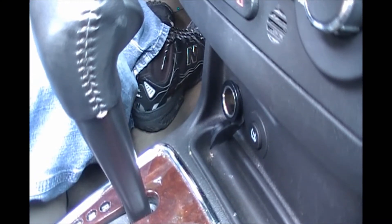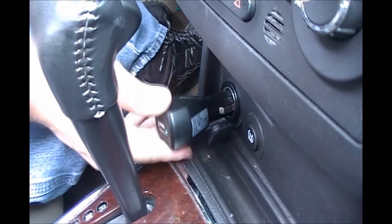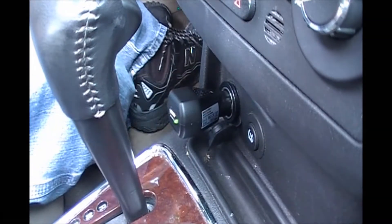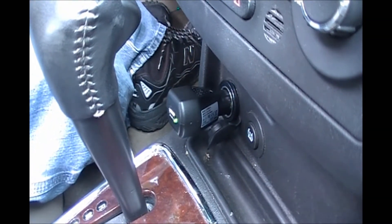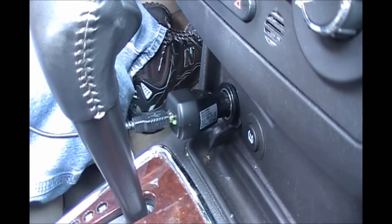After you've connected the cable to the booster, you now need to provide electric. Take the included cigarette lighter to USB charger and plug it in. Then take the USB cable provided and plug it into the cigarette lighter. Take the other end of the USB cable and plug it into the bottom of the booster, beside the coax cable.